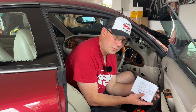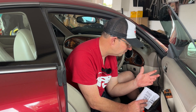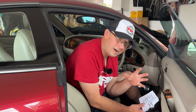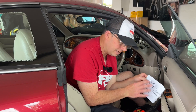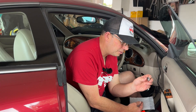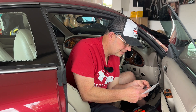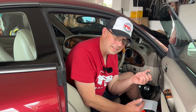Making a few inquiries on the web and through contacts in the XK community — thanks to Gerard Boo for his suggestion — he'd had a similar issue where random codes popped up, accentuated by temperature. On my drive where the error occurred it was okay on the way to my destination, but on the way back when the car was hot these issues appeared. Gerard suggested the issue on his car turned out to be the capacitors on the ECU board. The ECU is a mini computer and capacitors are probably the most likely components to wear out. In his case they had started leaking and shorting the circuit board, and replacing them fixed the issues.